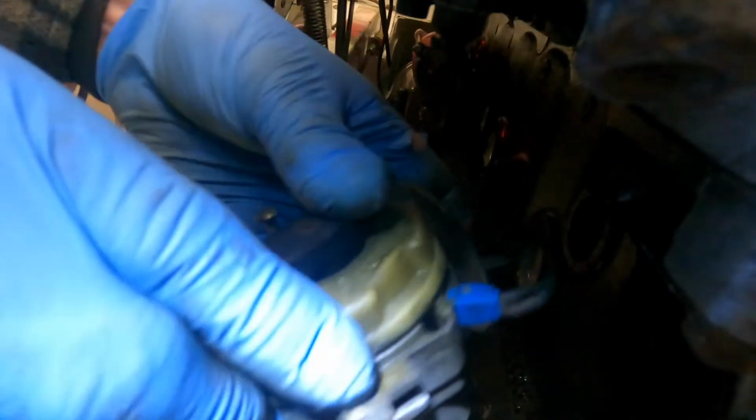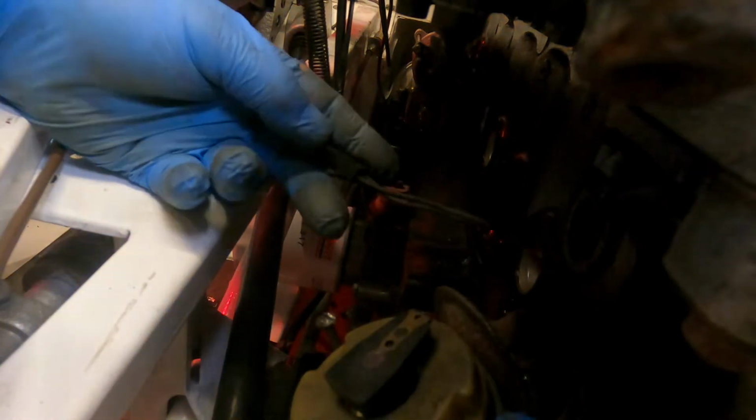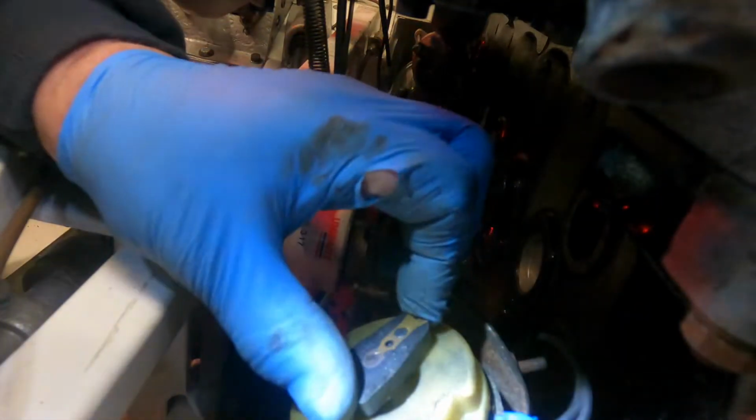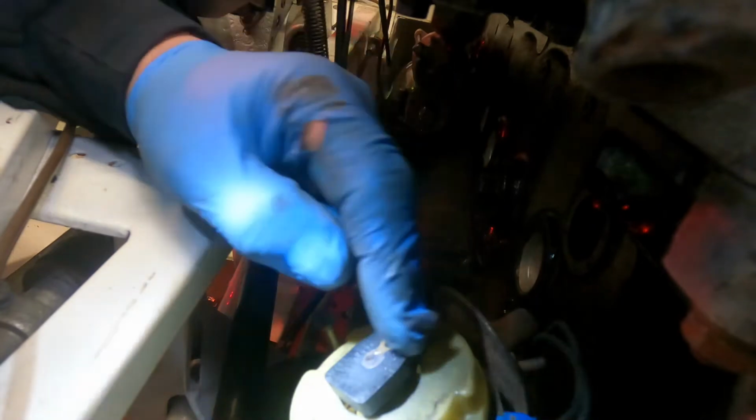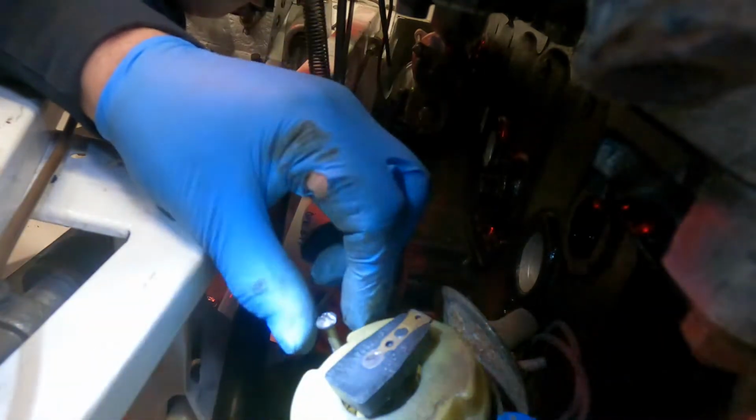Oh, God. That's really annoying me, because that is telling me that's 180 degrees out. So that's now come round. That's dropped straight in. There you go. So right, for the people who can actually see this, if you're interested, that now is clockwise and it's hitting number one. So that's number one cylinder. Number one is the back cylinder close to the bulkhead, and so that now is timed up.